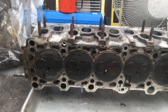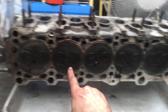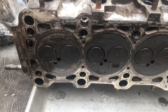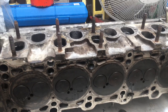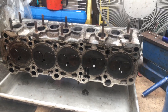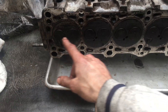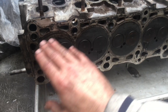I'm just checking this cylinder head. We've got number one — that's the exhaust on cylinder one, intake on cylinder two, and intake on cylinder four. Actually, that isn't too bad. I reckon a good cleanup on those faces and they'll seal fine. I've got to check all the valves to make sure they're not bent, but I don't think there's anything wrong with this head. I'll carry on doing some more tests, clean up the water, clean the face up, and check for any cracks — I've had a look and couldn't see any cracks anywhere on the head.